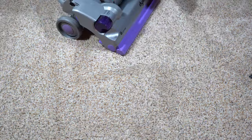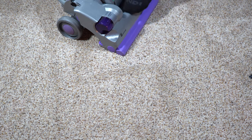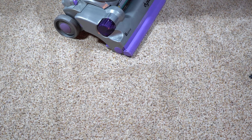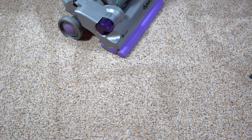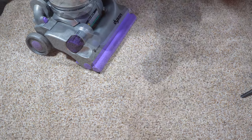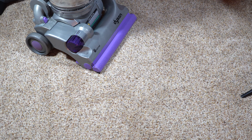Headphone warning. That sound you just heard is what happens when you stall the brush roller — either on too high of carpet, accidentally bumping the head, or when the clutch starts going out. When the clutch goes out, it doesn't always make that sound, but a lot of times it does, and that really scared a lot of customers. I think a lot of these lasted longer because it made that horrible sound and customers did bring them in.